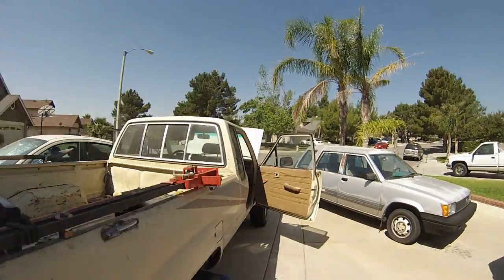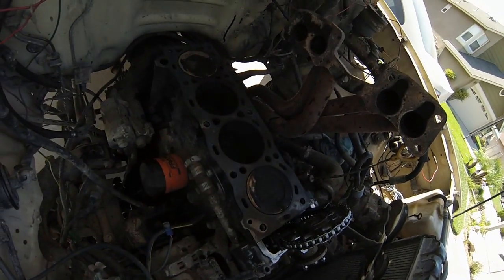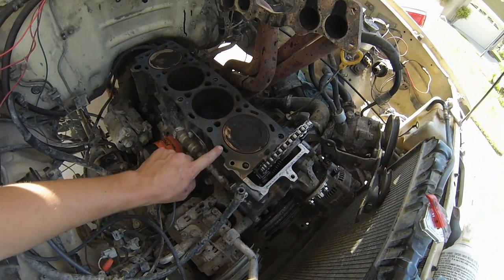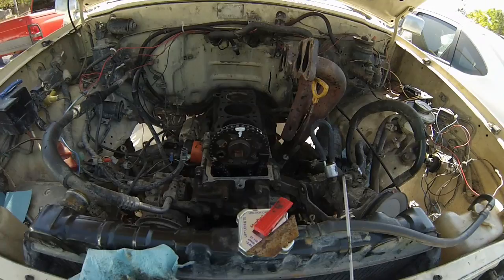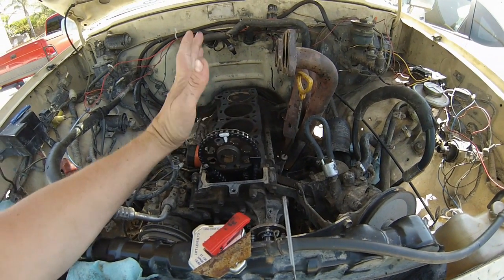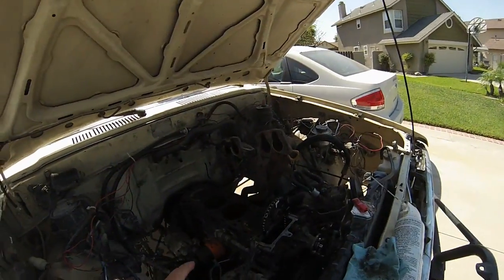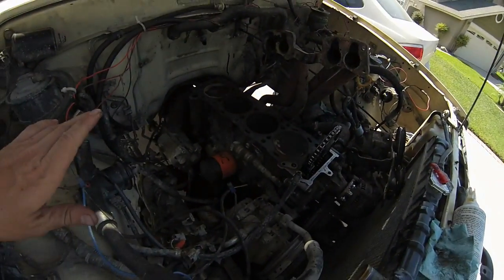There is the head and the block. I cleaned it out as best I could, went over it with my finger to make sure everything was scraped off. The timing chain is still marked and still at the very top position, so when I position the sprocket over the dowel on the camshaft at the 12 o'clock position it'll be perfectly on mark at top dead center. There's a tightening sequence for these bolts — you want to do it in four stages with a good torque wrench.